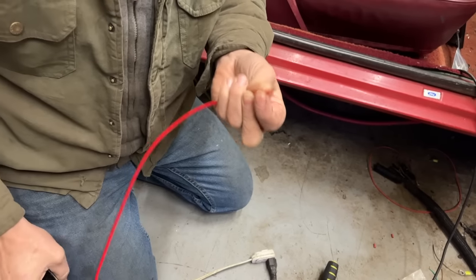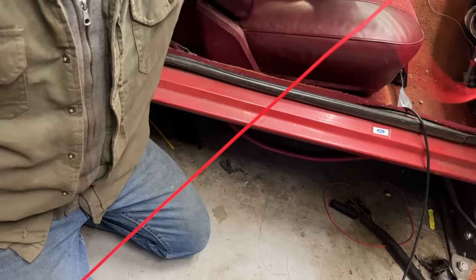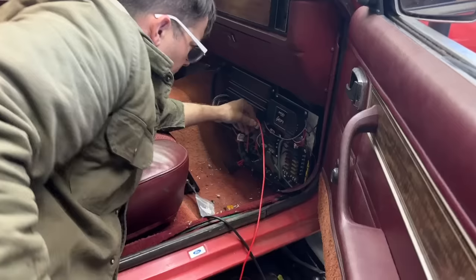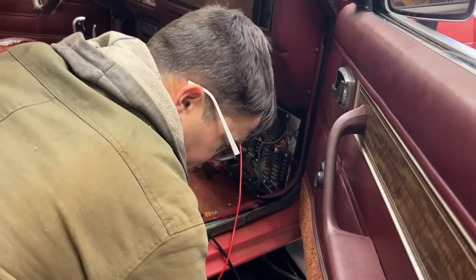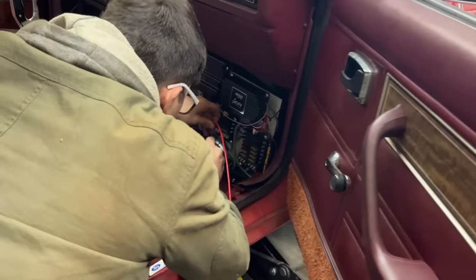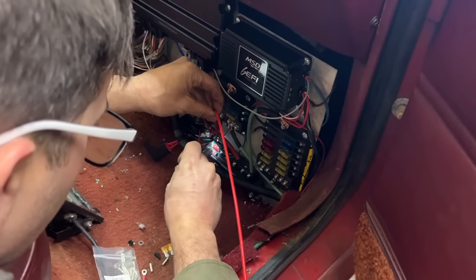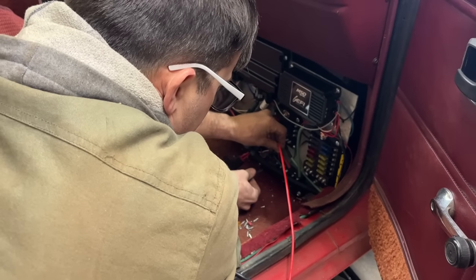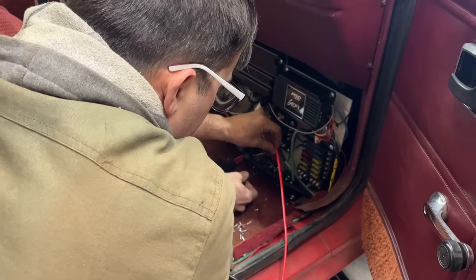And we're gonna run a 10 gauge wire back there from our solid state relay. I guess I'll just take the whole roll here. I moved the pins around a little bit on this from where we had them yesterday. So our fuel pump pin is going to be pin number 4 now. So it'll go right in here. Is that just tightened down on the wire? Yeah, you don't even have to put a connector on it.